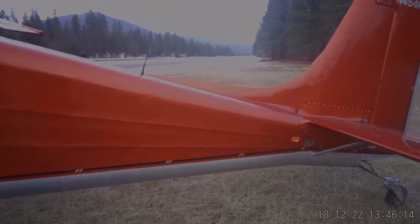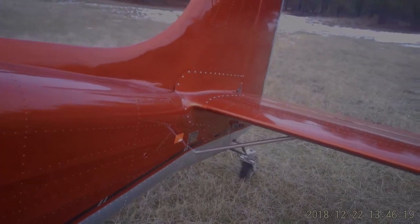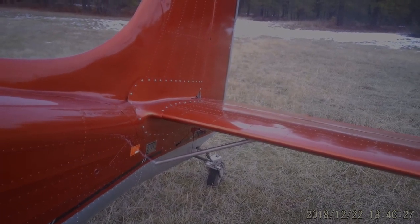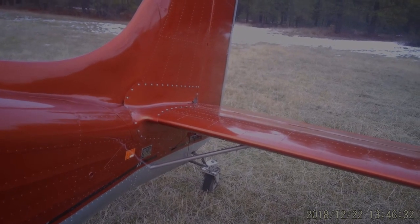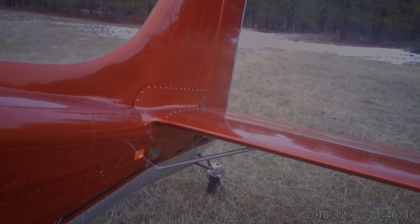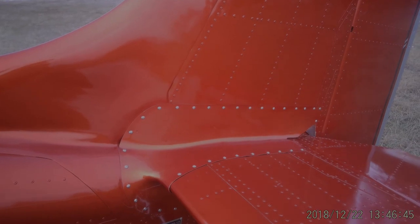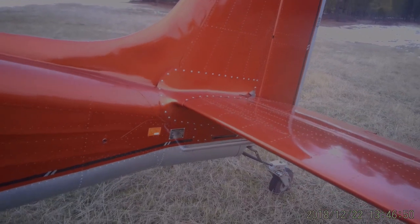You can see the rivet lines down the side of the fuselage here — did a lot of reinforcements on the back end of this airplane to strengthen it. It's been one of the weak points; there have been some problems in both ground and water ops, and we did some significant things to increase that. You'll also see here a strut brace for the horizontal stabilizer. This is a big wide platform, a little over 11 feet, and I've seen a lot of these where on this fiberglass fairing there's been a lot of cracking, which is indicative of a lot of movement of that stabilizer.